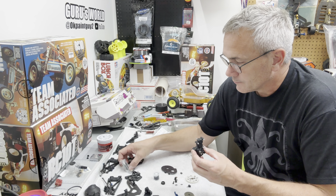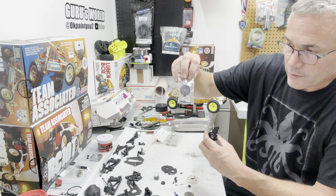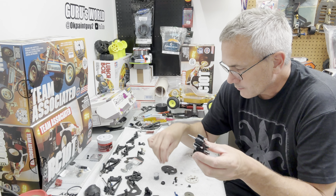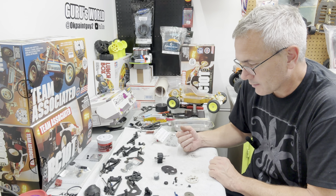I don't mind the blue because it is aluminum and it's lightweight, but I'm not super concerned about those few grams. I did have to rebuild the diff — I did not film that. My buddy Chris did donate a fifth gear and a rebuild kit, and this is the old one out of it. It felt pretty crunchy and we got it all put back together, all silky smooth now. New thrust bearing — the one you have to put together with all the little balls and the grease, the one that doesn't come pre-assembled like the new cars do. We cleaned up the out drives with Scotch-Brite and got a little surface rust off of them. Replacing these screws with stainless. I don't have a new gasket — I don't think it's super necessary, we may just glue this back together with just a little touch of CA right there.